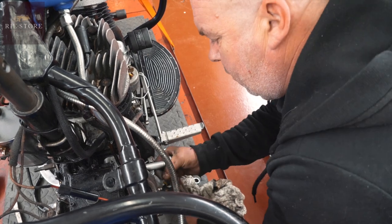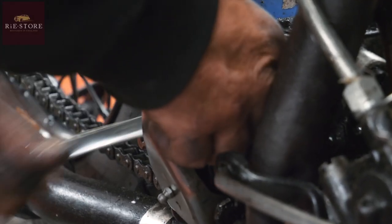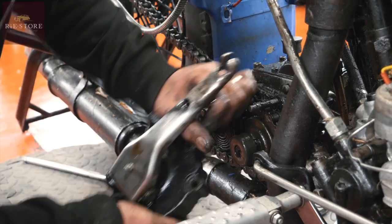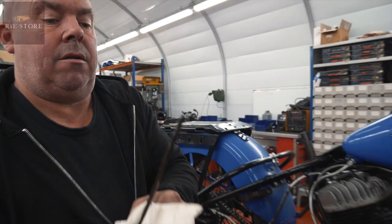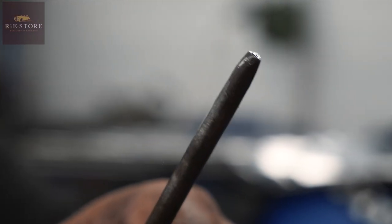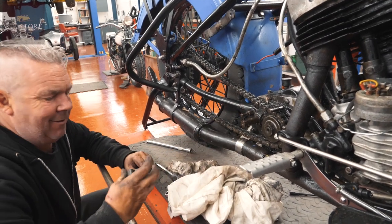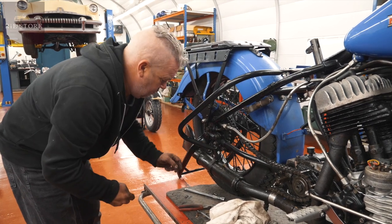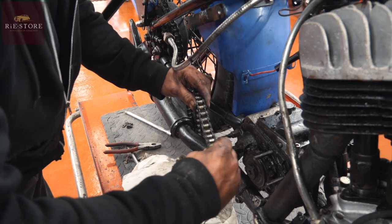Let's take the outer cover off. That's why that was wedged in the end of that thing — it shouldn't be tapered off like that. They are tapered off slightly, but not as much as that. Somebody's filed it or done something weird to it. Let's find the King Link — there he is. Come off. How bollocks can you get one gearbox? That chain is seriously knackered — you can make it bend within that much length.